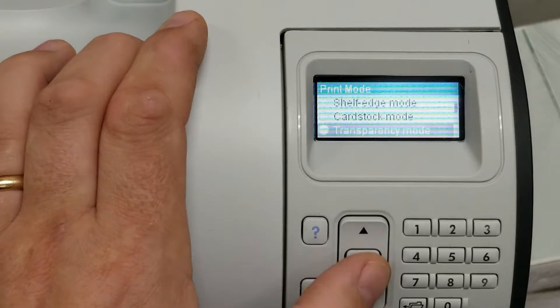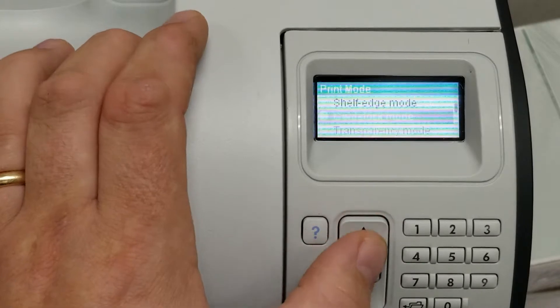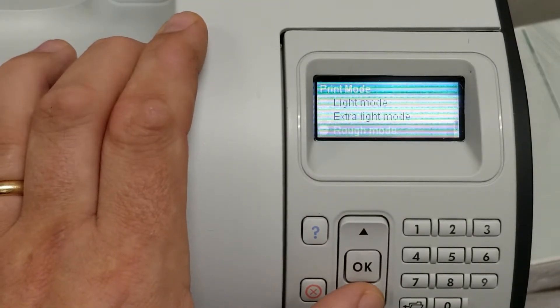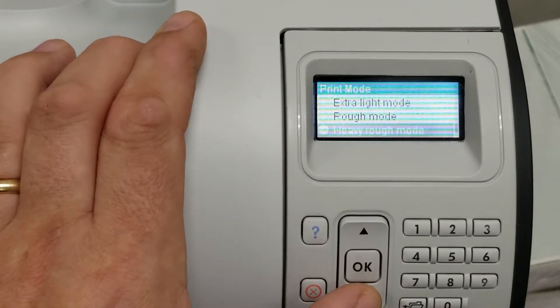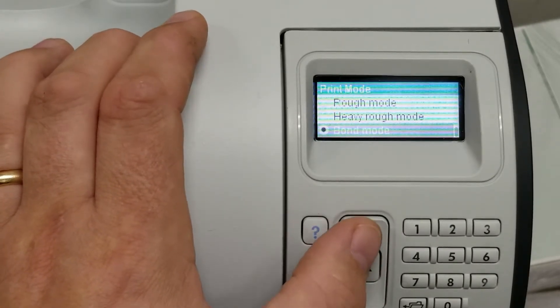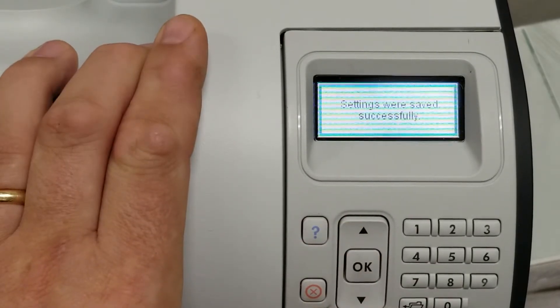These modes are not necessarily in order of intensity. Bond is probably less hardcore than cardstock or even label mode. But the one to start with is generally Bond — Bond does a good job of making sure the toner gets in there. If the toner is still not adhering or flaking off on the micro — if you give it a basic thumb pad rub test — you can go up to heavy rough mode, rough mode, cardstock mode, or whatever you need. Once you've selected the mode you want your plain paper to act like, you're set.